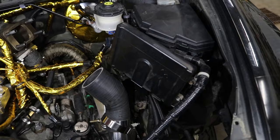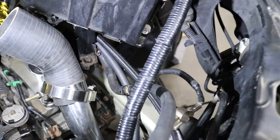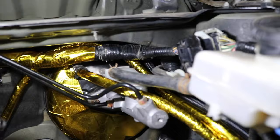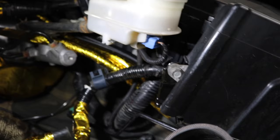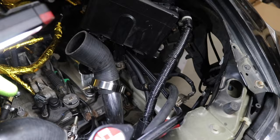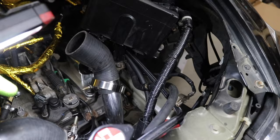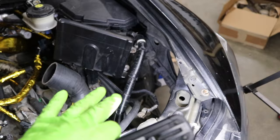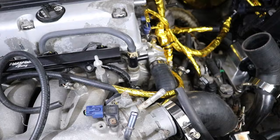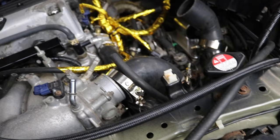This is looking super good so far. All of our lines are coming out from behind the ECU down there — nice and clean. If you look from the back, you can see where the AN line hooks up for the fuel line, where our purge line is going — they're all going up above the brake booster and running along underneath the brake master cylinder right there. I'm trying to decide if we're going to do these lines going underneath the frame or on the inside of the intercooler pipe without hitting the shifter linkage. We're not going to finalize this side of the lines yet. We got the check valve made, we got our AN line made — we'll just have to cut this to length. Same with our vacuum lines for the wastegate, brake booster line, and we still got to install the purge valve somewhere.